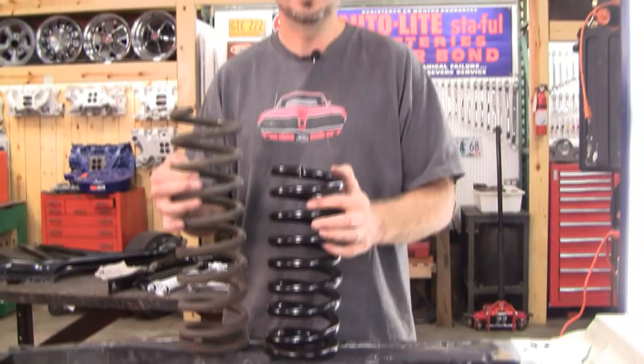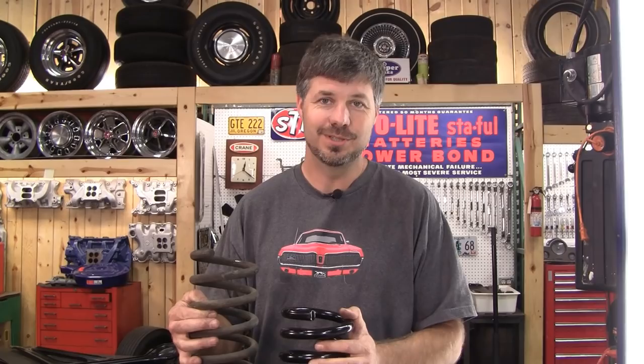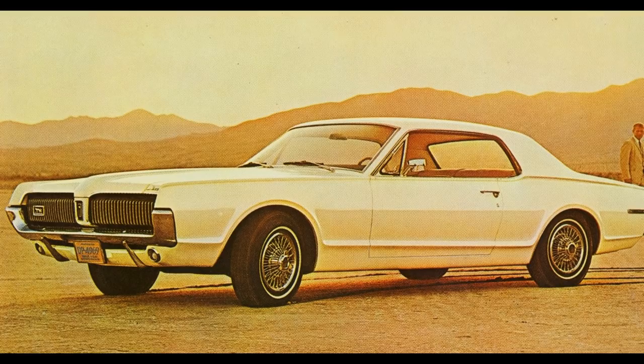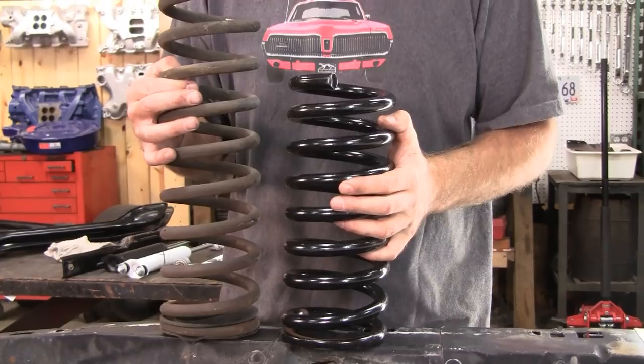While we're at it, let's look at coil springs. They aren't very expensive — about a hundred bucks for a quality pair. A lot of people don't like the factory stance of the '67-'68 Cougar. If you look at the original brochures, they kind of had a reverse rake — they sat low and back. As years go by, the leaf springs sag and get worse. I like my Cougar sitting level. One way to achieve that is not to cut a little bit off your coil spring — that's going to throw everything off. If you're going to lower it by making the spring shorter, you need to compensate with a heavier steel. This performance coil spring is designed to stiffen your front end and lower it an inch. It's not much money, and you've already got everything apart.